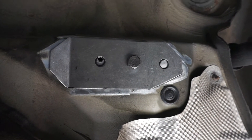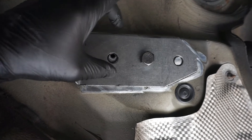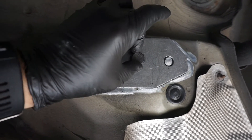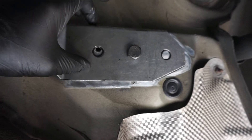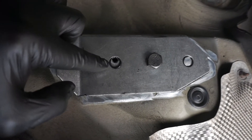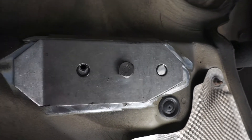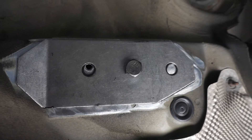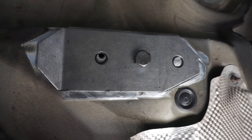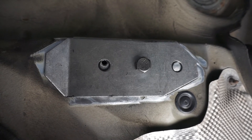Back under the car, you can see we've gone ahead and put the plate up. As I set it on the metal, I move it around just a little bit so I get coverage of epoxy on all the subframe material and on the plate itself. I run the bolt up that's provided in the kit, tighten the plate up against the body, and make sure I'm getting full contact everywhere. Some of the epoxy has worked its way out through the rosette hole, so we're going to get full rosette coverage too. We let this sit for a minimum of 24 hours and it should be rock solid — better than a weld. Let's install all the others and come back to show the final product.